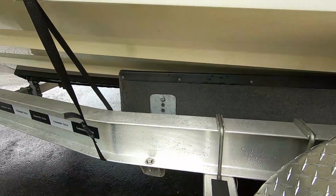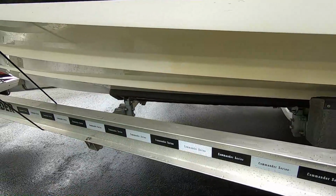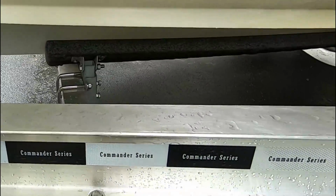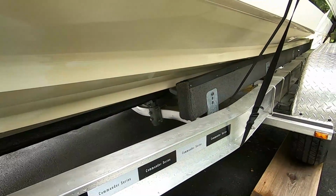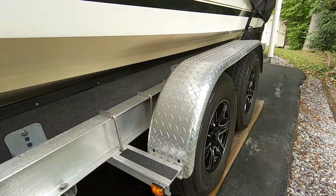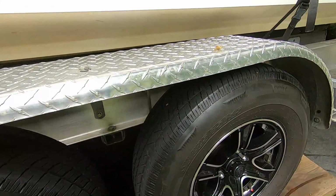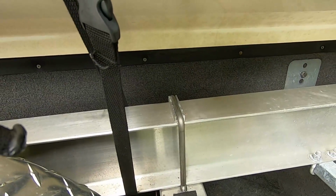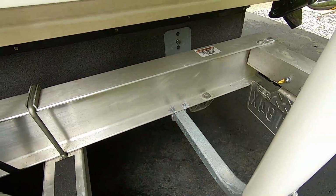Now, the bad. Well, hold on. With this trailer, I also got the stainless steel fasteners. Now, some people might be thinking galvanized, that's just fine. And it is if you're going to be doing just local trailering, or pretty much local stuff. But galvanized will eventually rust and it will eventually fail. Where stainless steel has a much better life expectancy, and it's just as strong. All my fasteners are just like the way they were when they came out of the factory, versus galvanized. See the difference?